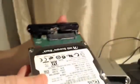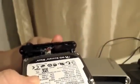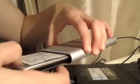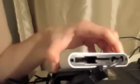So now we're going to connect the Serial ATA hard drive into the enclosure. Just make sure it snugly fits in there, nicely pressed flush against the connection. Make sure it's nice and firm, then gently slide it into the enclosure — it should be a nice cozy fit. Make sure the sides line up and don't force it. Once you do that, a lot of enclosures have little screws you'll need to screw in to secure the hard drive. Mine has two tiny little screws that I'm going to screw in on either side.